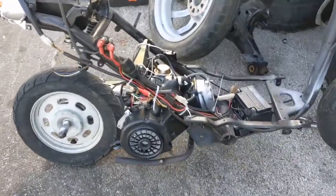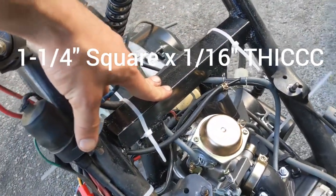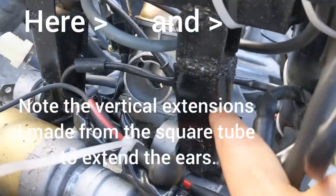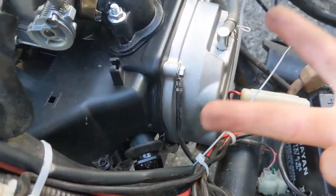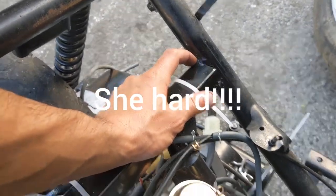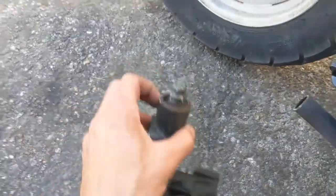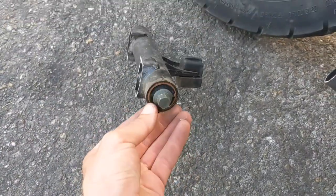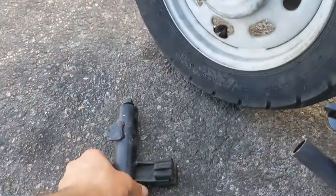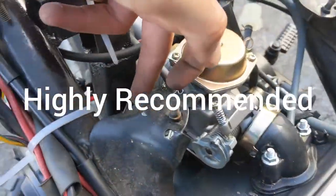The most obvious thing is making this engine mount. I have a square tube coming down - I cut off the old ears, the old mounts that used to be down here. There's a bar running across that the old one hooks up to. I chopped those off and put them here. The downside is it's a hard mount, so there's gonna be a lot of vibrations and handle screws coming undone.